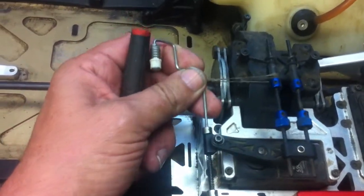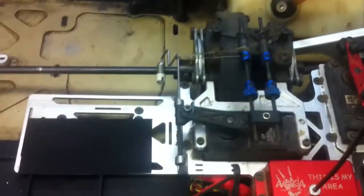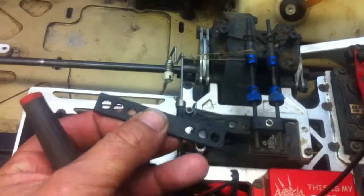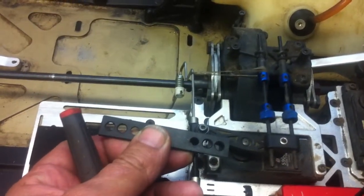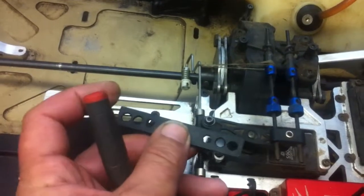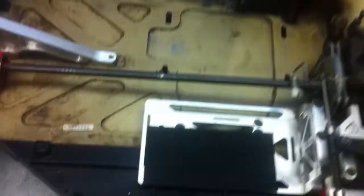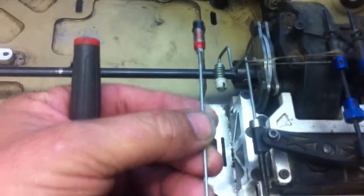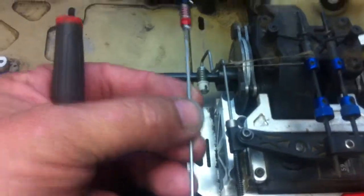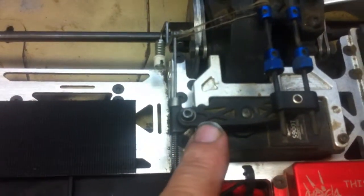However, that dental floss is eventually going to break. I saw another guy who put an extension out here on his servo tee and then put the throttle connection out there so it makes it a straight shot. You can do that just by having a straight linkage and that'll work — that's actually the simplest and the best solution, I think.